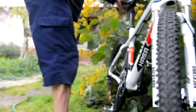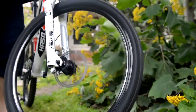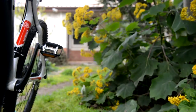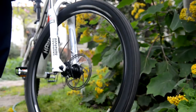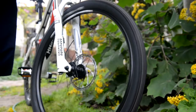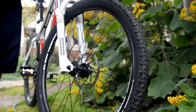The way my bike came, you can see there's a little bit of brake rub. It doesn't really slow the wheel down but I understand it shouldn't rub at all — it just makes a little sound. I tried reseating the brakes and pushing the pistons back into the cylinders a bit, but maybe it needs a bleed if there's a little too much brake fluid in the system. I might adjust that myself, but it doesn't really seem to be much of a problem at this stage, although that sound can be a little bit annoying.